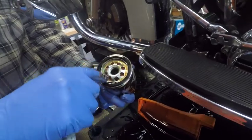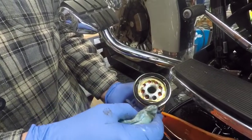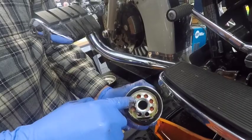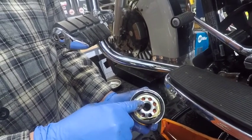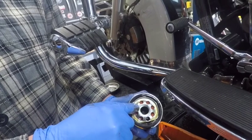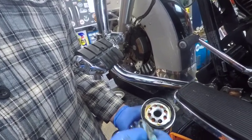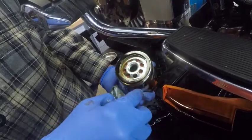I've seen this before where people use an older filter on a twin cam motor - something made for an Evo motor. You see this membrane in here? That orange? That's a bleed-back valve, so the oil doesn't bleed out of the filter back into the engine case. I've seen guys use a twin cam filter on an Evo motor. Is that a bad thing? Well, it restricts flow - it's not a good thing for an Evo motor. It's just a flow issue. Just a little tidbit of information - it's a bleed-back valve inside of it.